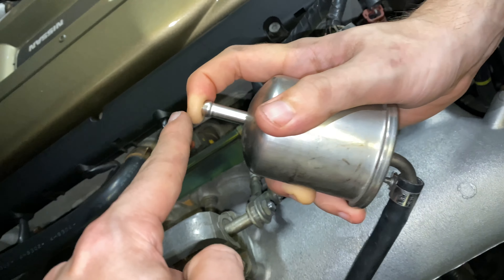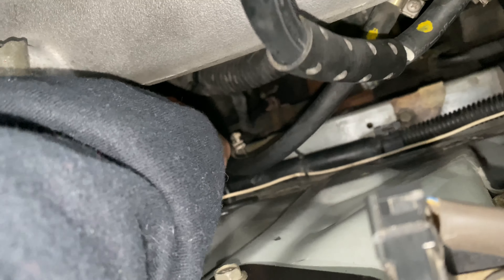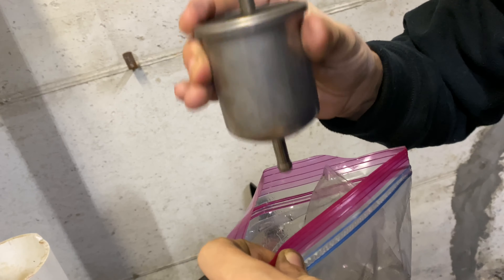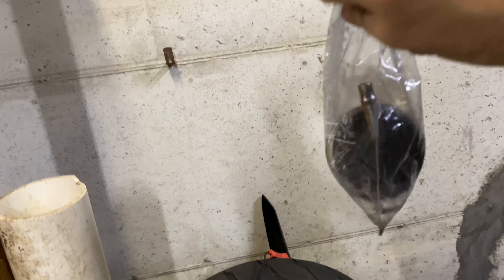Right now he's holding the bottom because it's spraying gasoline otherwise. So we're going to put this back on and tighten her up — should be good to go. New fuel filter. We are just shaking the fuel filter and you can see that is all fuel but dirt also coming out from this old fuel filter. It is crazy. That's probably not going through your engine all the time, but just think about how much dirt — 20 years of just... who knows when that was last changed.